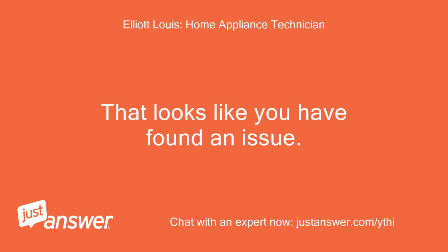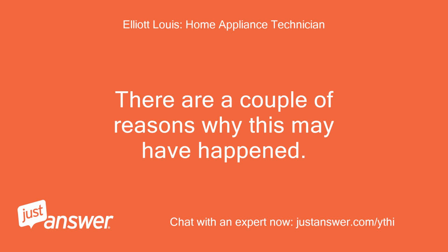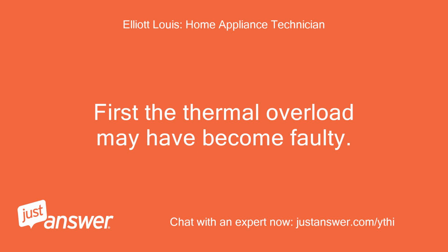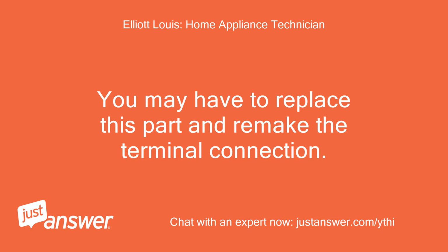That looks like you have found an issue. The black on the terminal cover is a good sign that this has overheated or there has been a spark that has caused a problem. There are a couple of reasons why this may have happened. First, the thermal overload may have become faulty. Or second, a loose connection to the thermal overload. You may have to replace this part and remake the terminal connection.